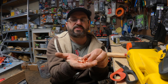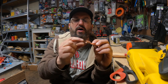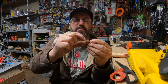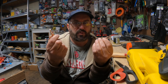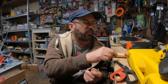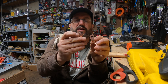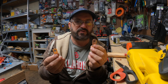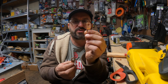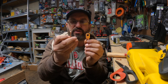Next up is lugs. You're going to want to make sure you get pure copper, and I also recommend that you use ones that have these little flares on them — they're just easier to put in. They come in different gauges, of course, and you're going to want to match the gauge to your wire. But in addition to that, you're going to want to match the actual stud size. For example, this is 3 eighths and this is 5 sixteenths. So if you're using a 5 sixteenths terminal post, you're going to want to use the matching lug for the tightest, best connection.